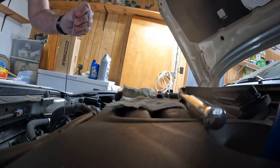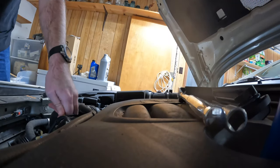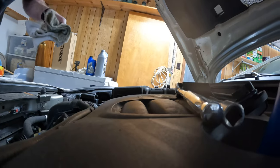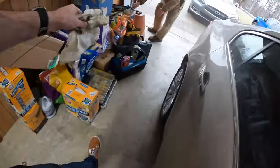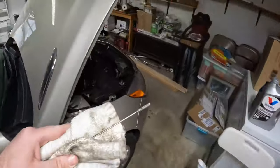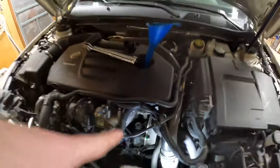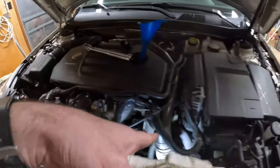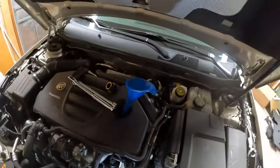Now what we'll do is put the dipstick back in, just for curiosity's sake, see if there's any left. Like I said, when I did this at work, there was like three drops coming out of the drain plug. And there is nothing on the dipstick — as you can see, there's like one little drop right there, but there's nothing. Something else I recommend doing is where this car has the vertical filter, go ahead and take the filter out — the old one — so all the oil drains back into the engine. You don't want to drain all your oil and change the filter and have the oil run back into it. We went ahead and changed the filter first, so now we're going to put oil in the car and it'll be done.